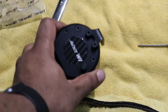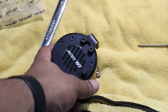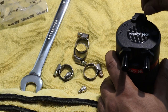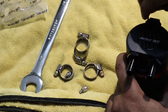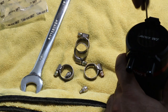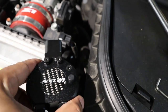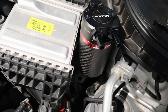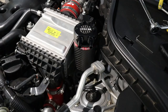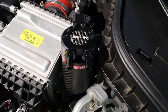The best way to install the catch can is to remove the small bracket that comes with it using 2.5mm allen bolts, then reuse those bolts to mount the catch can on the bracket you just installed next to the intercooler. Loosen them up and remove. Check clearance — make sure the hood shuts without marking anything, that it clears the intercooler and the side panel so there are no noise complaints from potholes or acceleration. It moves a little but is pretty stiff.